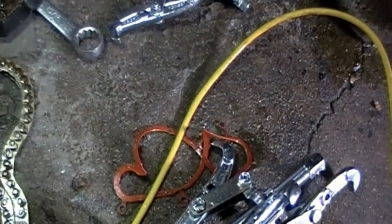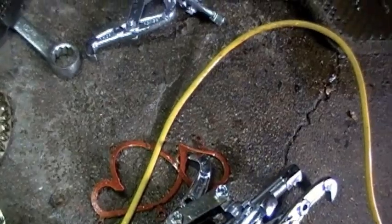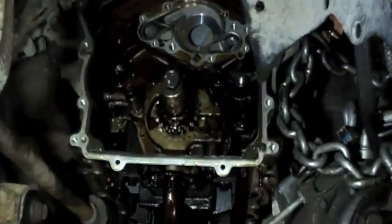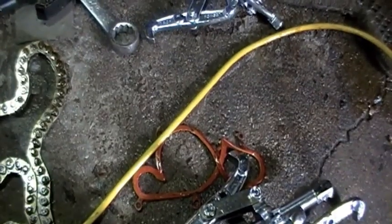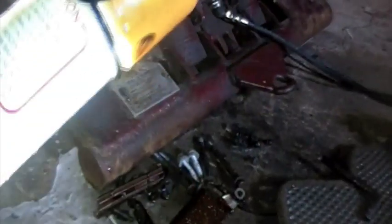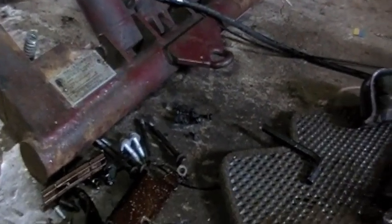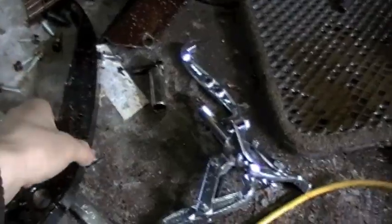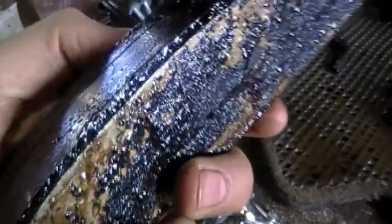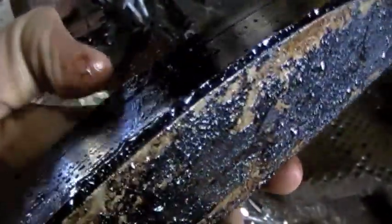Here's the water pump gasket, which is actually still good. This is the second water pump for this motor - the motor has 200,000 kilometers on it, and it could have been replaced at a hundred thousand kilometers because sometimes they go prematurely, which is actually quite common. Down here is your primary timing chain guide, and you can see there's a bit of a wear ridge - you want to replace these, otherwise your timing chain will be too loose.